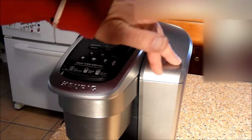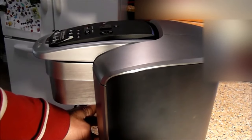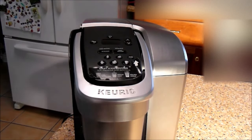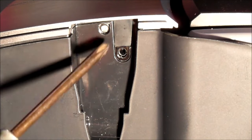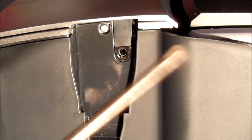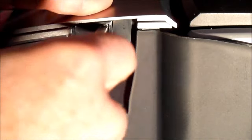We're going to now start to remove the top cover here. The top cover is all one piece all the way around, and it has to be removed in order to get access to any other areas down below for servicing. You can't get this shroud off totally until you remove the top piece. We'll start by removing this screw here. This here is a port that empties water back out into the external water tank. The external water tank goes here and down below.